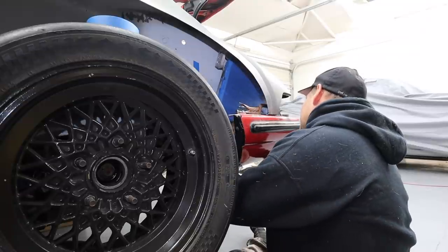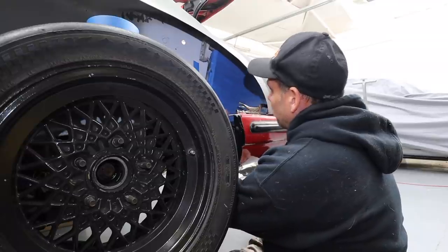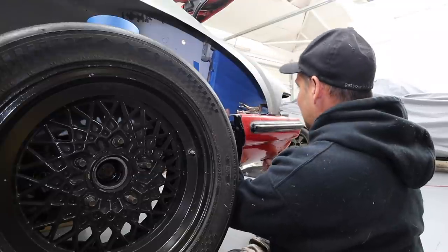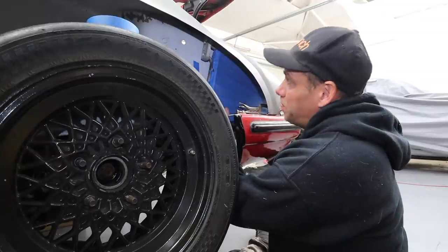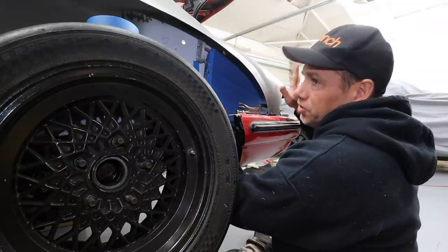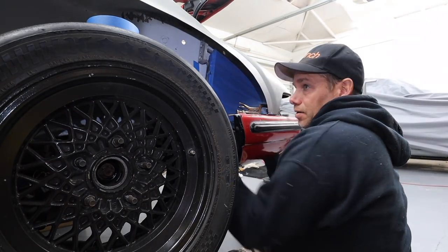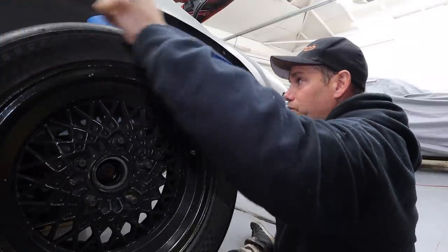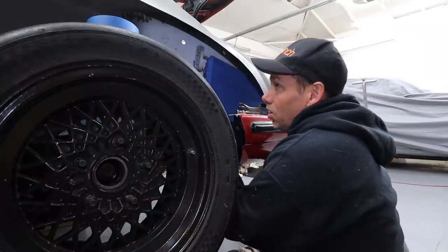If I get this thing tucked up in here nicely, I should have no problem. There's going to be a fan on this side and rubber bushings on the inside, basically separating it from the chassis of the car, with a little bit of airspace. Maybe I'll have a push fan or a pull fan, and then another one up ahead. I'll run them in series — the air conditioning line will come in, go through one cooler, to the other one, and then back to the front of the car.